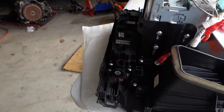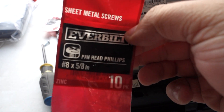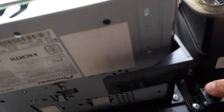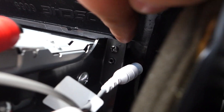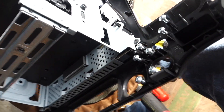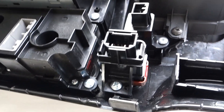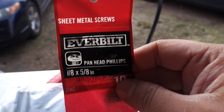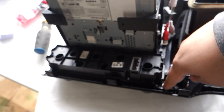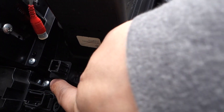You're going to need these screws. The screws that come with the kit are for right here where the bracket mounts to the main chassis. The screws on your factory panel are too thick — they end up breaking the joints where they meet, so you don't want to use those. You want to get thinner screws; Home Depot has them or you might have some laying around. Then cross-start your screws — start here, go there, then here and up here — working them down at the same time.